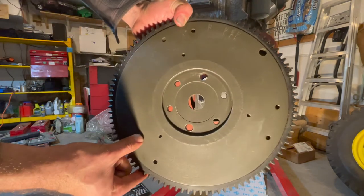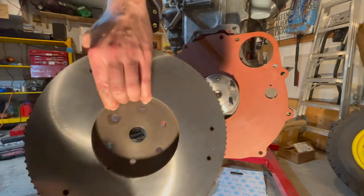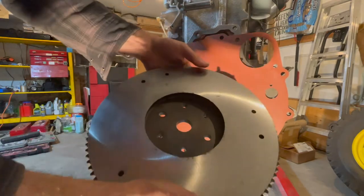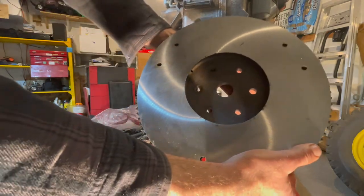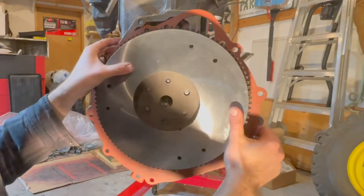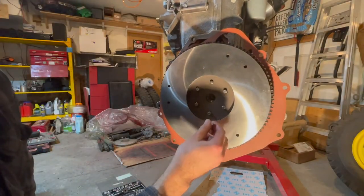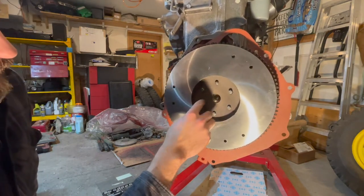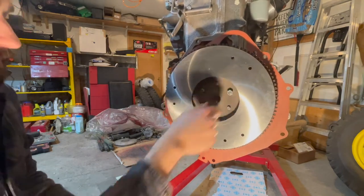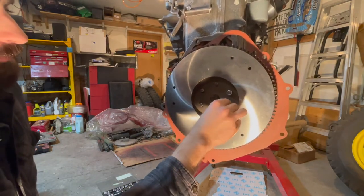Now with the 97-tooth flywheel, you will place it with the big metal pad facing towards you and stick it on the holes, but make sure you line up the bigger holes with the dowel pins. Slide it on — it's a bit tricky to get the flywheel on sometimes, just wiggle it back and forth. With the tapered dowels in the right holes, now put on the six nuts — that's why we re-tapped all of these bolts, so it's easy to get the nuts on.